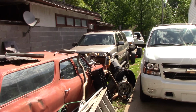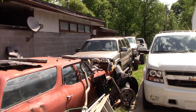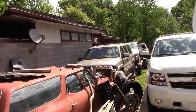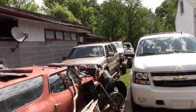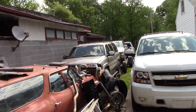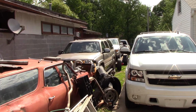And the 6.0 out of my truck has always used oil and has always used antifreeze. I think it's got a cracked head. So what I may do with it, because it has such good oil pressure and has low mileage, only 158,000, to me that's kind of low mileage, I may go through it, put a set of rings and rod and main bearings, the normal stuff you would do, clean it up, and maybe put a set of LS6 heads on it with the same cam, and that may be the one my son-in-law gets in his 05 Chevy truck. We'll see, but that is a good combination for a two-wheel drive truck like his extended cab.